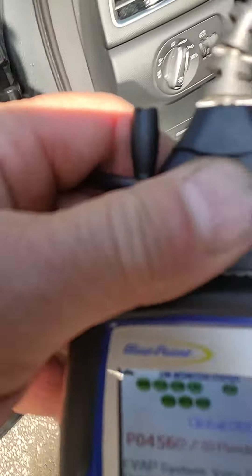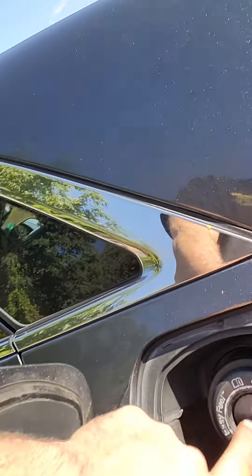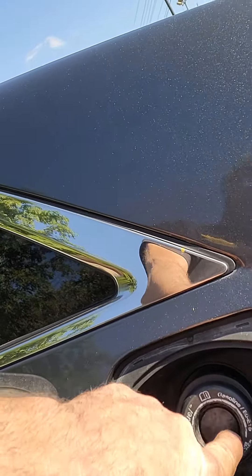There are also many other things that cause EVAP problems, but you want to start with the simple thing. As a consumer, you want to check the gas cap. So we're going to order an OEM gas cap. These style here, they can be maintained, but they do need to be replaced too.